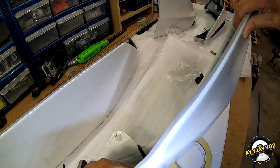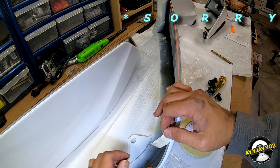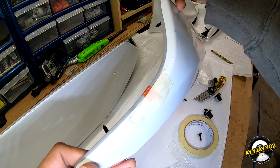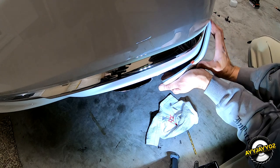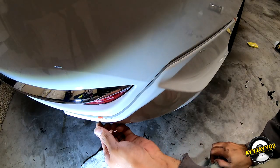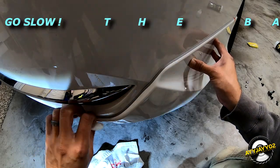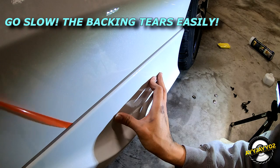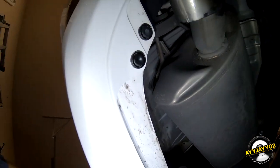We just need to get the double-sided tape prepped on this — just get a little piece of tape. You peel the double-sided tape back just a little bit so it can lip over like this and tape it on there. Then you do the same thing with the other one. The last thing is to pull the cover off the double-sided tape. When I pull on it, I always make sure I pull straight up and just pull it right along. The rear is done.